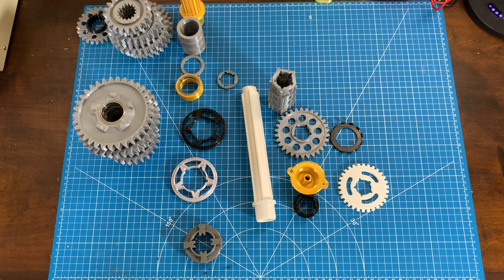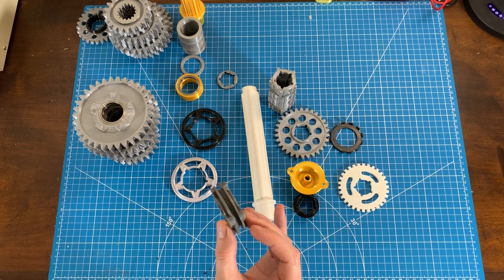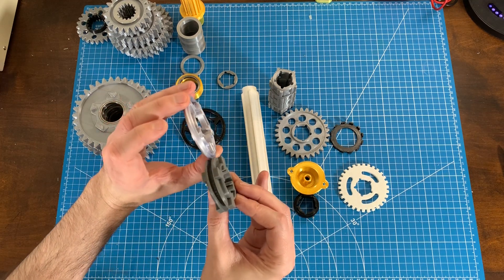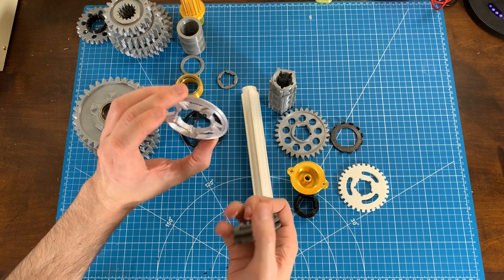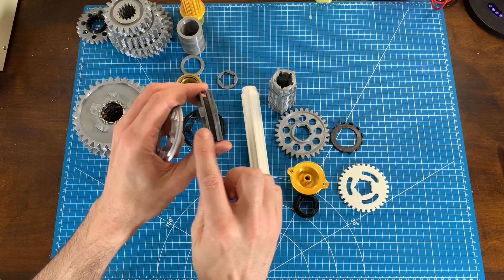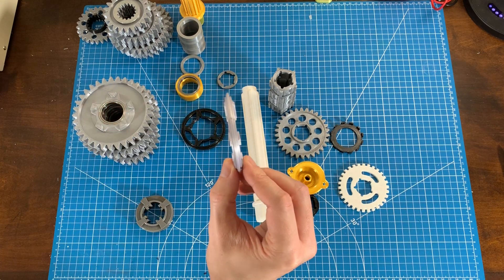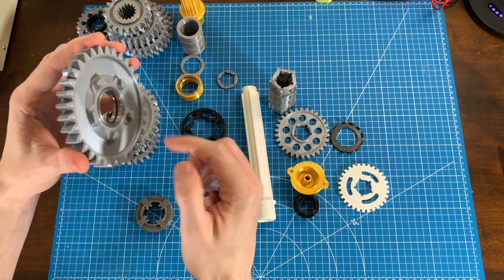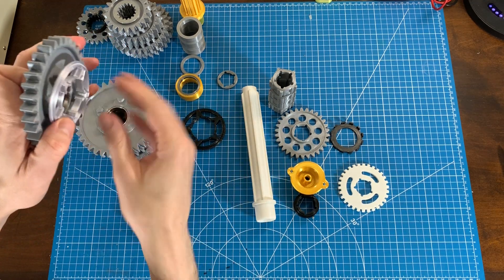The first thing that needs to get assembled is the main shaft. But before that, I wanted to show one of the really cool innovations that an F1 transmission has over other transmissions. This is a slider from my previous sequential transmission, and as you can see, the slider from the F1 transmission is actually thinner. The reason for this is an innovation called internal dogs, where the holes that the dogs go into actually go all the way through the slider. The dog only goes halfway through, but it eliminates the space required for the shift fork to sit between the two dogs. This alone takes five to seven millimeters out from between the gears so that the gears can get even closer together — and the dogs themselves are actually sunk a little bit into the gear itself, so the gears can overlap and get even closer.